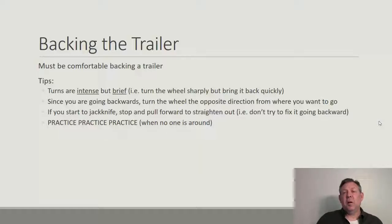When going backwards, you turn the steering wheel in the opposite direction. So if you want the boat to go that way, you turn the steering wheel the other way. It's not like just backing the truck up — since you've got a trailer and a pivot point, if you want the trailer to go that way, you need to turn the steering wheel the other way to make the truck go the other way. Another tip: if you have to consciously think about that while doing it, you're not going to do it very well — that's why we practice. A lot of people suggest putting your hand at the bottom of the steering wheel and moving your hand where you want the trailer to go, but I prefer hands up higher.